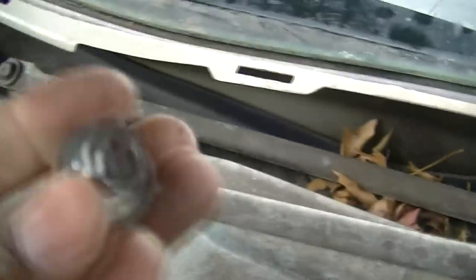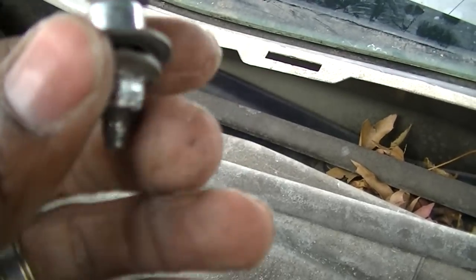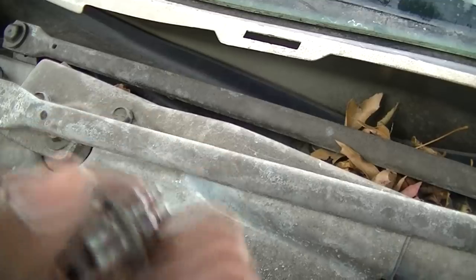Drop it. I started to jump the gun already. Started pulling out the bolts and everything. I didn't get the one that's all the way back there yet. That might be a problem, because I had a problem with this one. As you can look and you can see, there's a Torx bit underneath. That I didn't know. I did not know that. I used the gun and twirled that thing out till it got hot and melt through the plastic. I have a situation. This one back here may do the same thing.